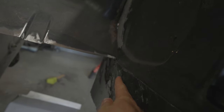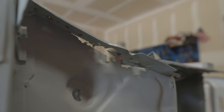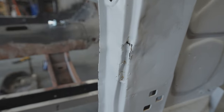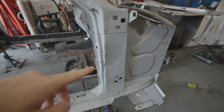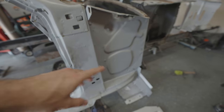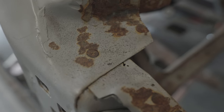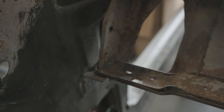The other issue is there used to be a little piece here that held this part of the firewall — I cut that out because part of the torque box has to come up through there. I'll probably have to cut this edge off. But first I need to take care of this kick panel — there's a little bit of rust. The pillar looks like it's been crushed at some point and actually tore through the metal, ripped off pretty good. Eventually I'll have to replace that, but I can't remove it without bracing everything, so I really just want to focus on getting the torque box done first.